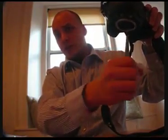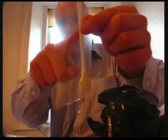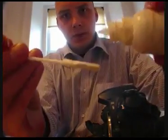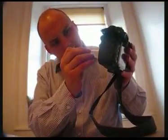So blower from below, quite strong blowing. Remember there's a little hole in here that sucks in air. So that's again why you don't want to do it in a dusty place. Get a new clean swab and always open it from the other end. Sensor cleaning fluid, 3 drops, 1, 2, 3. Then give it a little flick. I think that's good. And then right in there.